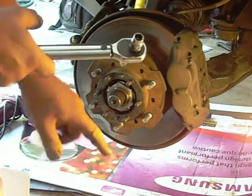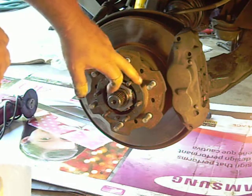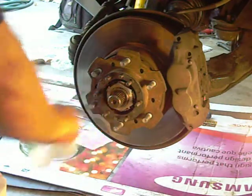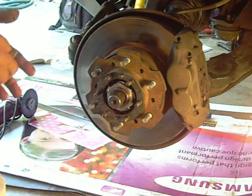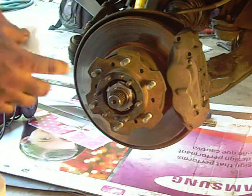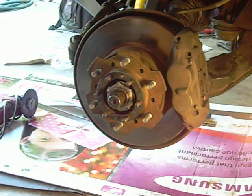You're going to be bolting the cover to the body at 7 pounds after you make sure everything's working. I already replaced the gasket here from the Warn premiums, and it's in perfect condition — nothing wrong with it, nice and smooth. Just make sure there's no grease where it's going to join. It's going to ooze out a little bit from when I put all new Japanese OEM bearings and races back in when I did my rotors. Once I get the hub body and hub assembly completely on, I'll clean up the brakes and replace some retaining pins, springs.